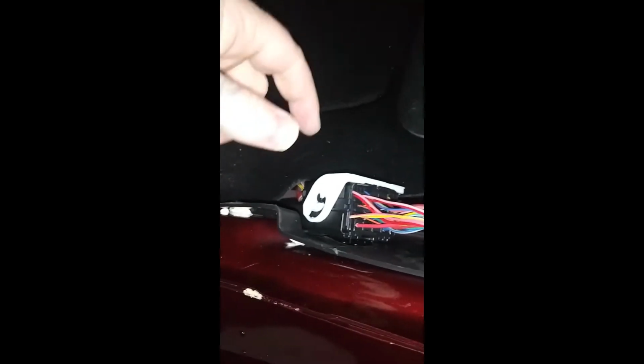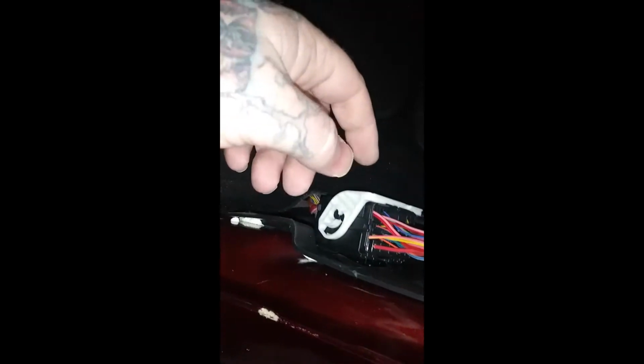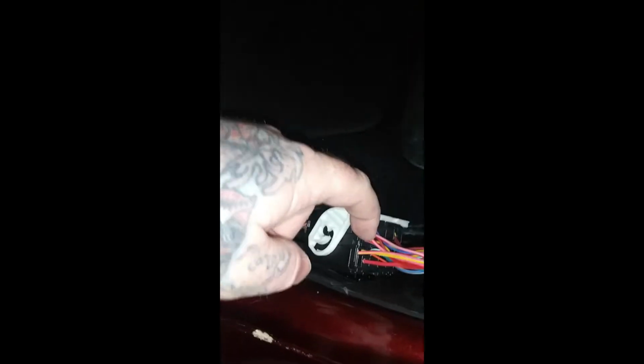I'm going to pull over. Oh, sorry, I dropped the video down on you. Like I said, this one back here, it's dark red. There's no lines on it. It's probably going to be your constant. So I'll show you how you test that, make sure that that's good. And then we'll start testing these other wires for your ignition wire. And then obviously a ground. I'll show you where we put that.